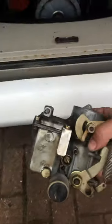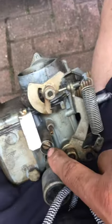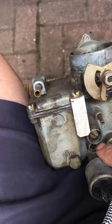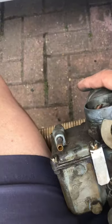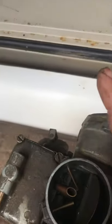I'm going to give this a good clean — I'm going to take all the valves and jets out and blow them all through with air. Let me point them out to you: that's your main air screw, people tend to use that to adjust the tick over, and you've got your volume screw which is your fuel — I have it about one and three quarter turns out. My van is usually about two turns out, and that tends to give me an okay setting to start from. And as you can see there's a jet in there.